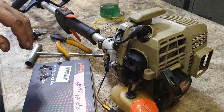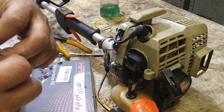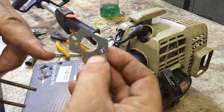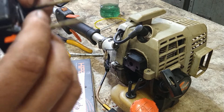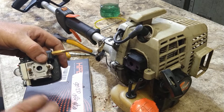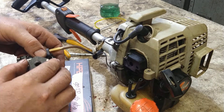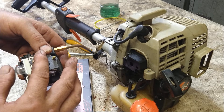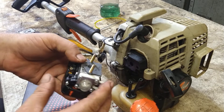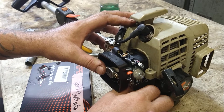There's a gasket on this one — there are usually a couple of new gaskets in the kit. This gasket goes on the air filter assembly side; it doesn't matter which direction. Then put it through the carburetor. This other gasket goes on the carburetor so that the little holes are pointing towards the nipples — those are the vacuum ports for the fuel pump that's built into it. There's a vacuum port on there too, so all of that has to line up. Then push the bolts through the intake block or isolator block.